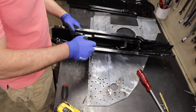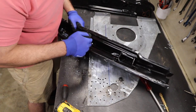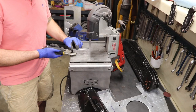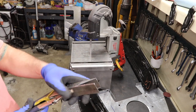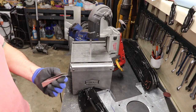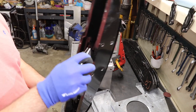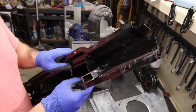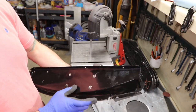To fill this gap, I have some of this stuff here — if I cut it and squeeze it down, I can make like a wedge. I think that would work. Like that — just pin that in like that and then squeeze it in there. It's actually not a bad fit. Obviously cut off the excess, grab that in there, and just spot weld to that. I think that's what I'm going to do. Just got to do it three more times, plus four on the other side. I just realized I can't really test fit it the way it was, so what I'm doing is basically making a box — that's my wedge.